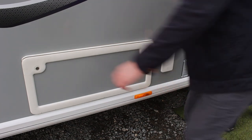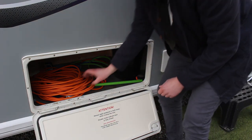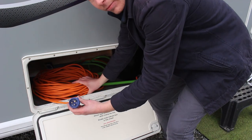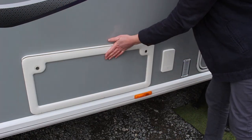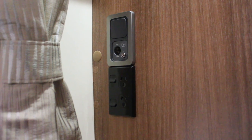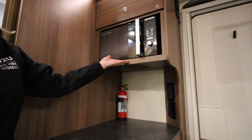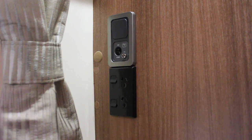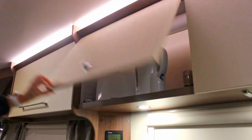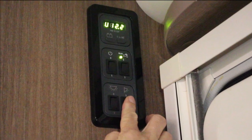Your caravan comes with a 240 volt cable which will fit an approved camping outlet. If you wish to plug into a three-pin house supply you will need a special adapter which can be purchased from a camping supply store or hired from us. This powers the three-prong 240 volt plugs, the fridge, the microwave and the Truma heating and hot water system. You can check the caravan is receiving 240 volt power by testing the jug, toaster or microwave. The lights function off the solar-powered battery and cannot be used to test if the caravan is plugged in or not.